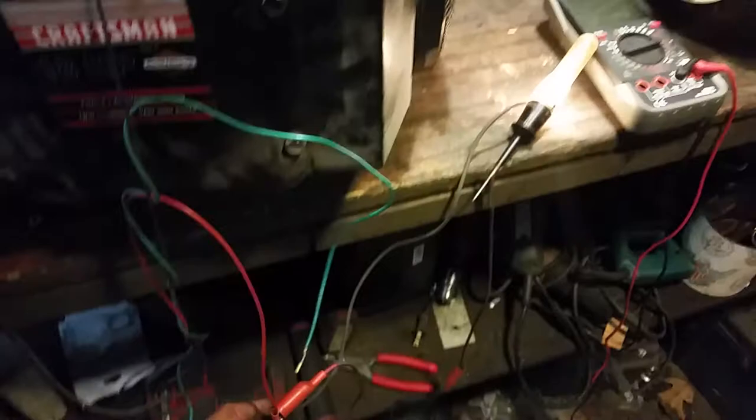This is just one thing to keep in mind — I have battery power hooked up to what the charging system is hooked up to. So in the case of the engine running, if the spark is not grounded out, it continues to run. Even though the key is in the off position, we still have power running to the accessories and/or fuel relay. So the fuel relay is not used to kill the engine.